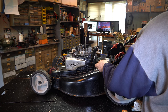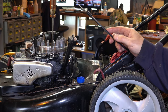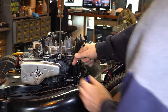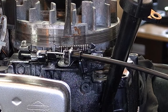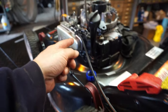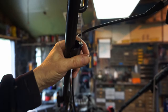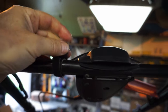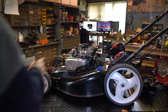These are Chinese cables — that's what you're going to get at a reasonable price. Just push the end right in. On this model I've routed it through here first, then snapped it in, brought it up this way, and hooked it onto the bail up top. Line up the hole and make sure it goes in all the way — it snaps right in. Then pull it back, velcro it, take the screwdriver out, and exercise it to see how it feels.